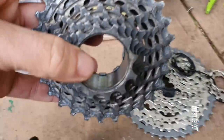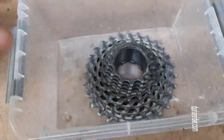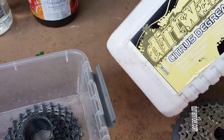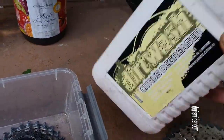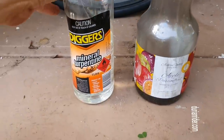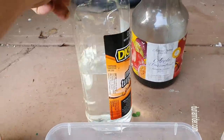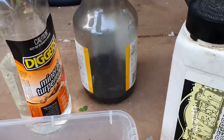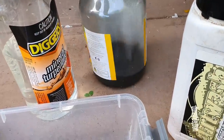So what does your cassette look like? What lube are you using? Let's chuck it in here. We can reuse this little container. This is some degreaser — a bit more eco. You can also use mineral turpentine, but don't tip it down the sink. I let it evaporate — just pour it on the cement and it'll just evaporate.